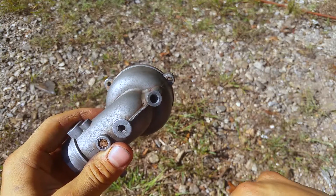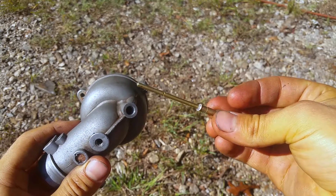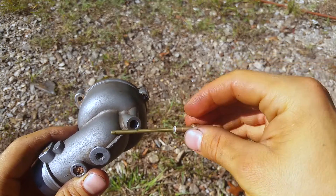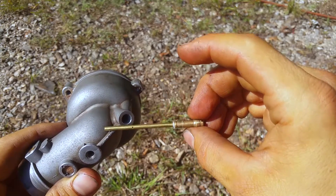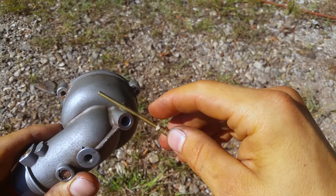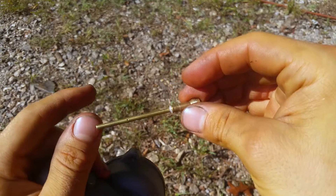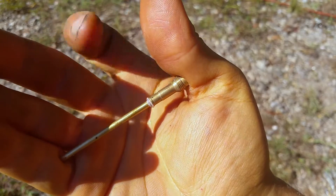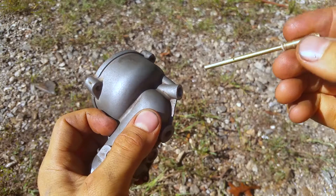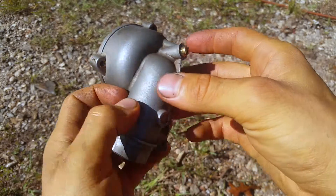Here's the last tip when working on these carbs. You can see I have the emulsion tube out here, and these have a problem with leaking. Right here, you see it has a Teflon sealing washer on it — it's paper thin, like parchment paper thin. There's a Briggs service bulletin PDF — I'll put a link in the description — that has part numbers for these little sealing washers. You get one and put it on there, and when you thread it in it seals. It leaks on this mating surface right here, and without this, the motor won't run right. Normally what happens is it leaks gas all out this little weep hole and it makes a mess.